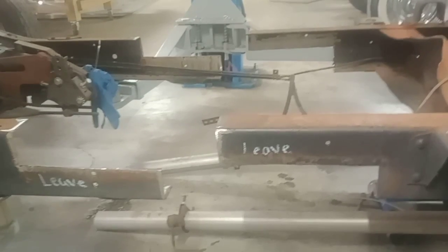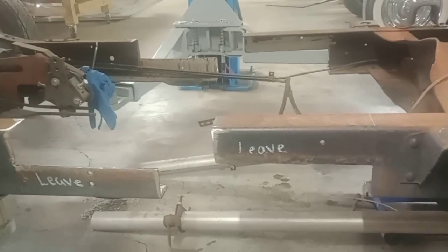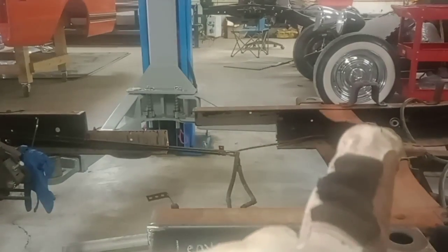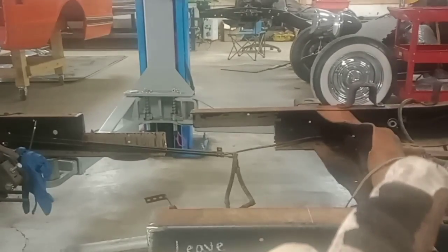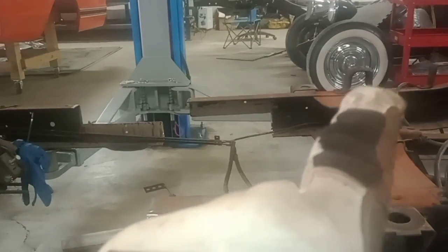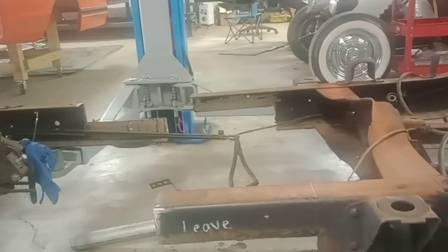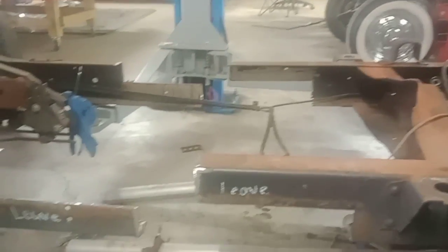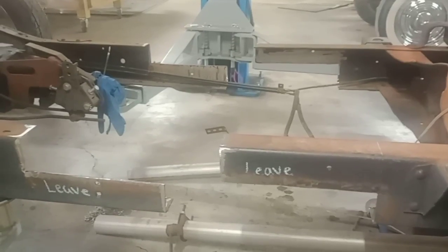I always clean up my whole frame before I even put it together. That way it's all cleaned up. There's a little bit more I need to do. All that stuff there will be going through here, sliding up through there. Like I said, I get a compression union and redo the brake lines after I'm done and join them together. Cut the 1 foot out of the brake line, and that's good. Get that at any local parts store.